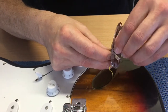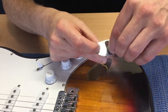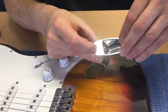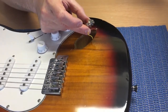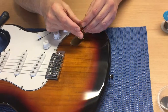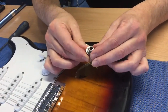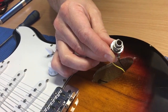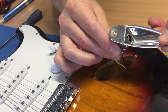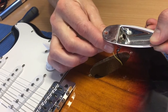I'll show you how to tighten it back up once we've made the repair. On the back of the socket you can see there's another little screw. How this works is the screw on this side and the screw on the outside of this metal plate comes through here, and the two of them are tightened up so that they clamp it into place to stop it moving around.